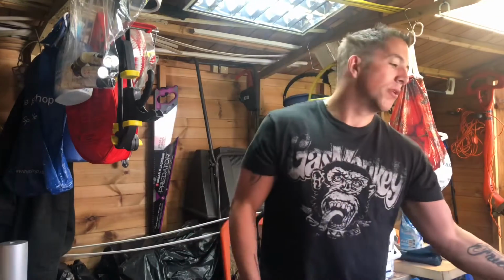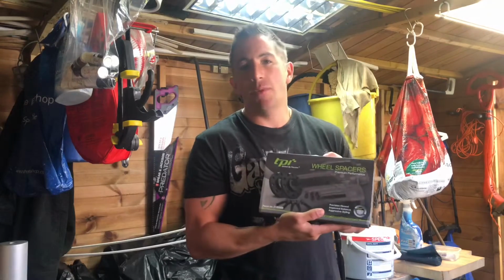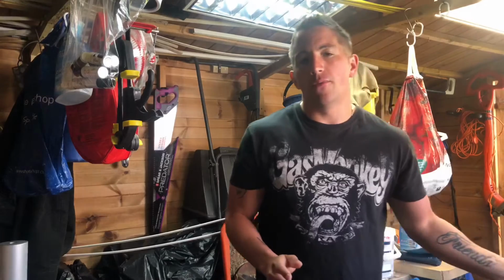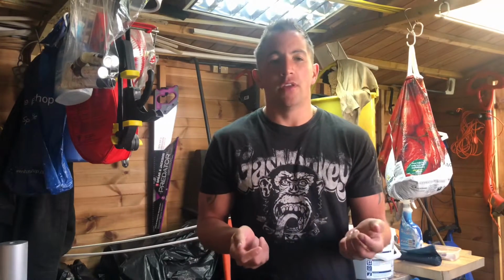In today's video I'm going to be installing a set of these TPI wheel spacers. The reason for this is when I bought my Brembos, after fitting, the stock wheel doesn't fit. So if you think of putting some Brembos on your Corsa, bear in mind your standard wheels won't fit, okay? So you need a set of wheel spacers.